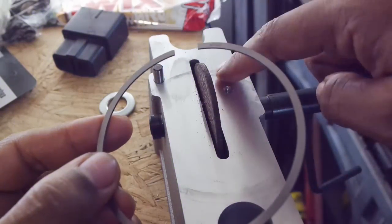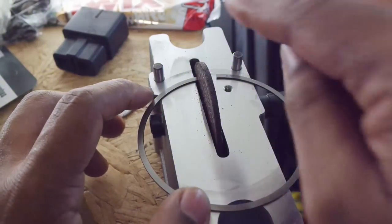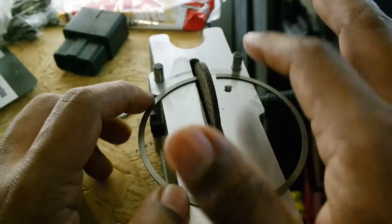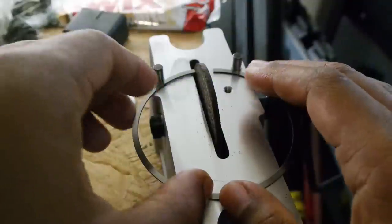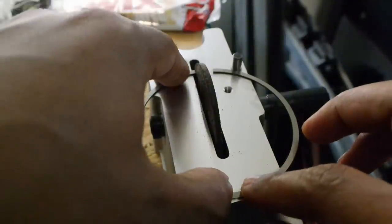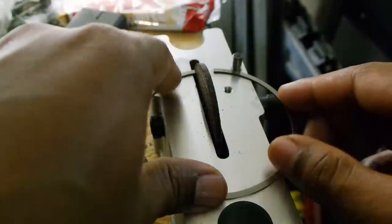These two pins are like guide pins. Another thing: when you're cutting your ring to gap it properly, you only want to shave one side — I've been doing the left side. You don't shave both sides. You pick a side and stick to it because one side's already perfectly machined flat and there's no point in doing both sides. You push the ring up against the guide pins and push the left side against the wheel, and you literally take your time. There's no perfect answer — it's not 20 spins or 15 spins. You're going to literally have to take your time and go a little bit at a time because you can't put any material back. It's better to do a little bit at a time and measure three, four, five, six times than to cut too much and then you're screwed.